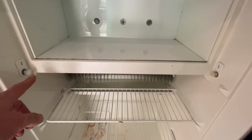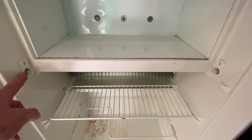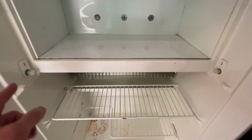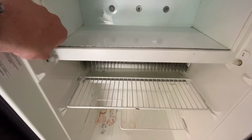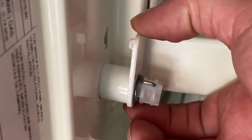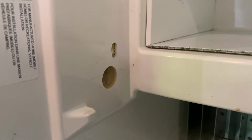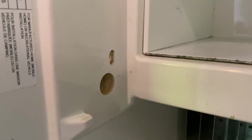Unless they popped out because of the spring force, when you remove the door, you will have a left and a right spring assembly. Don't get them mixed up. Keep the left on the left side and the right on the right side. You should just be able to use your fingers to remove the spring assembly from the receiving holes in the wall of the fridge.